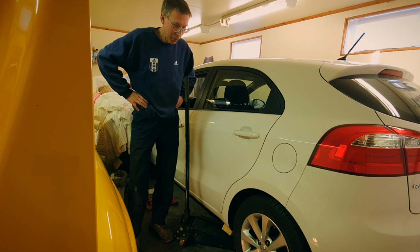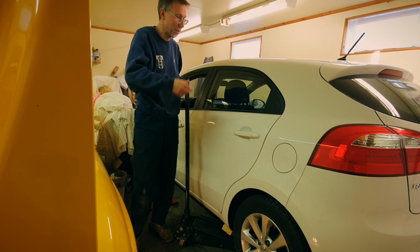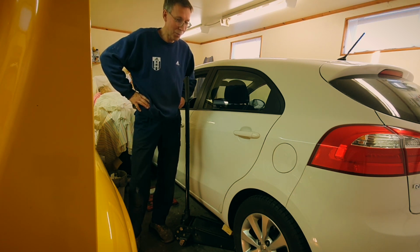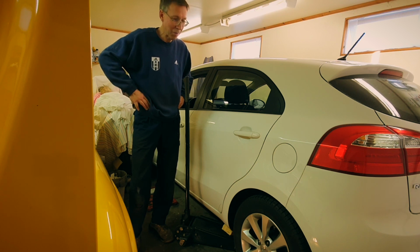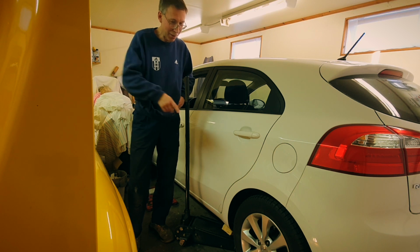My recommendation, when just driving and using a car, when it's been raining, is to brake and brake hard. If you've got an old-fashioned manual park brake, then apply it, especially when you're about to stop somewhere and park it, because then you will heat up the brakes a bit and take off the moisture.